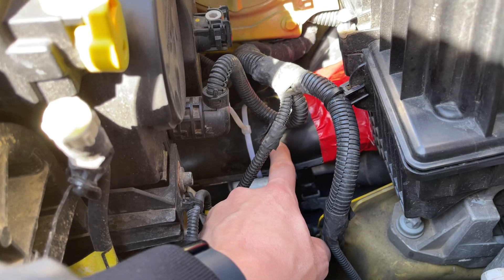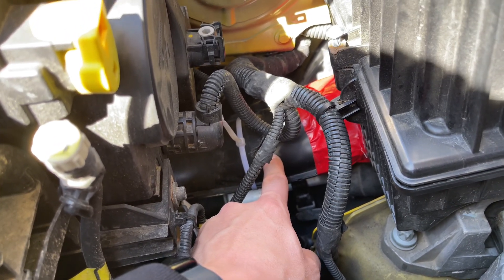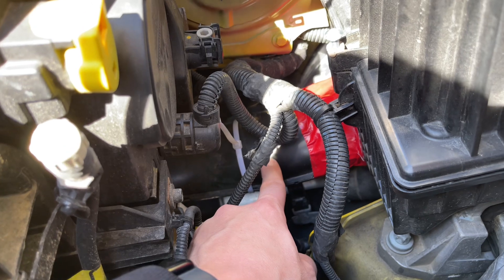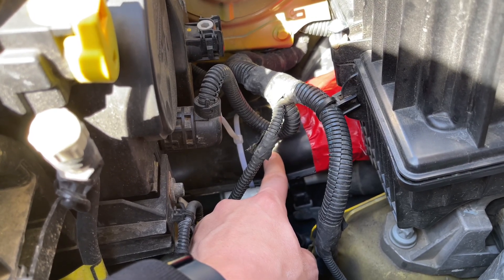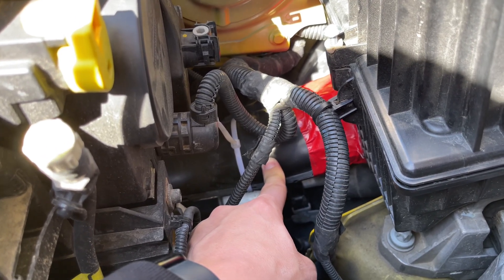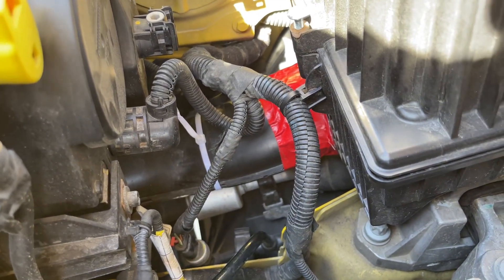This tube, right where the zip tie is, opens and closes — hot dog style. It's not supposed to, however there are plastic clips that I've worn out over the years. This is a 2015, so I know for sure the 2015 does have this issue. It basically opens and closes pretty quickly over and over again as you're hitting the gas in certain situations, and that's what causes it to vibrate and make that popping noise.